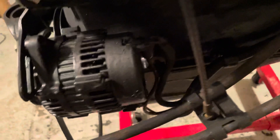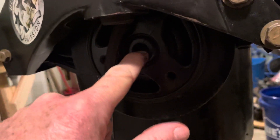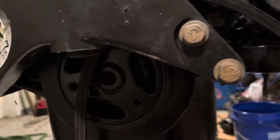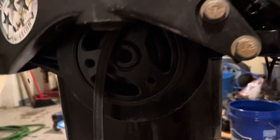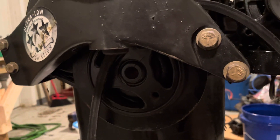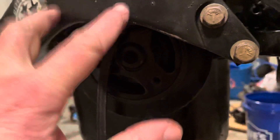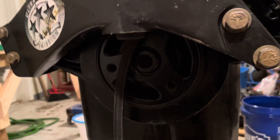Those two connectors went to your oil reservoir. I still haven't taken any of the harness off the back of the alternator — all I've done is take the belt off. For those who have not done this before, there's no bolt that holds this harmonic balancer on the front pulley — it's just pressed on. You pull it off with a puller. To get it back on, I'm going to make a special tool that spans from this bolt across to that bolt — it's going to be steel. I'll use a bolt that pushes this thing back on. Because otherwise you're not getting it back on, or you'd have to hammer it on, and I don't think that's a very good thing to do.